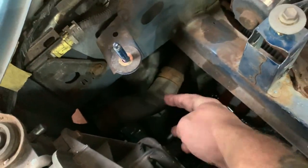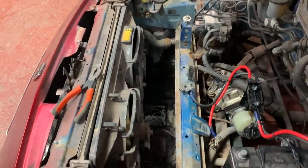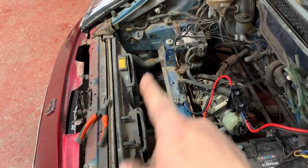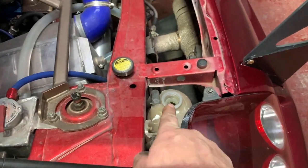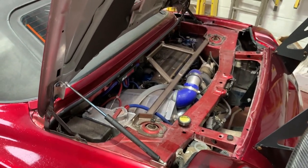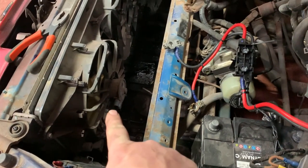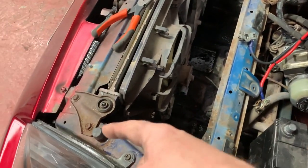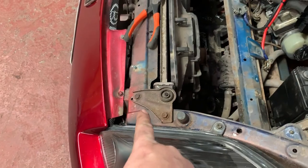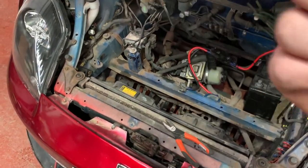That's all sorted and out. One thing you could do before you remove the hoses is clamp both of them - it stops you draining the whole system, because they're apparently a complete pain in the arse to bleed back up again. But I wanted to change the whole coolant in the system. If you do drain it like me, don't forget to remove the cap else it won't drain all the way down - you need to let the air in. Down there I've unplugged the fan, the two hoses are off. So now in theory it should be those two nuts there and those two there - take those plates off and all of that should lift out.